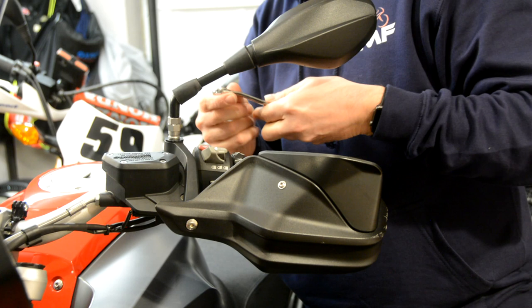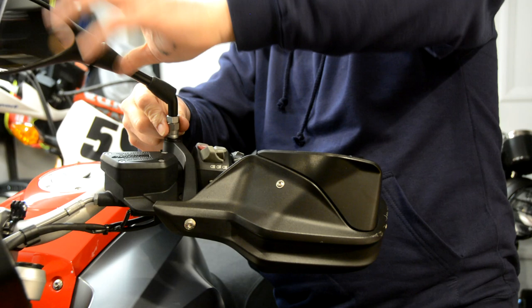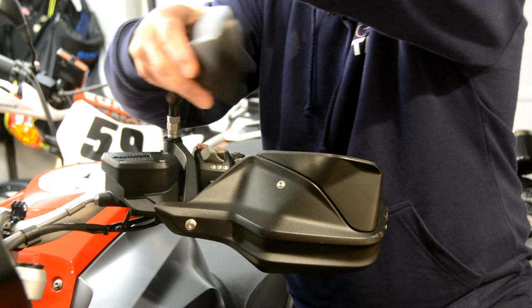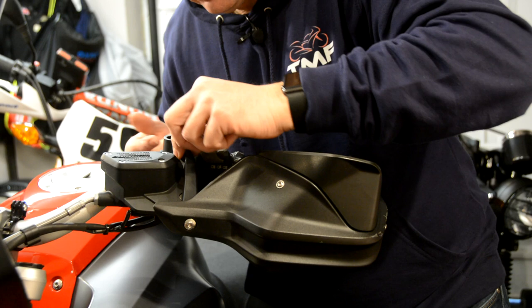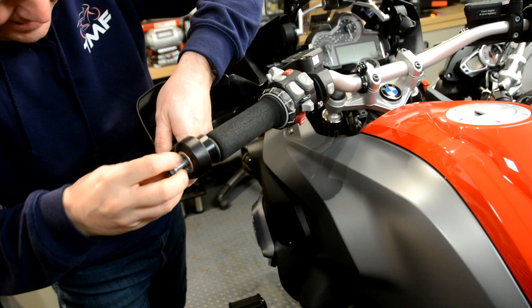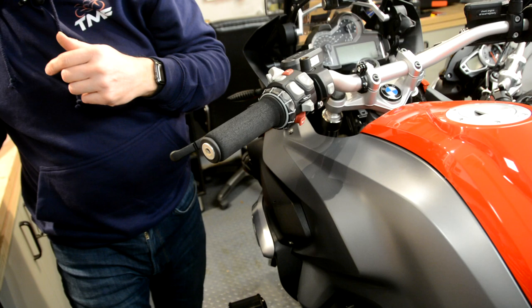Right — push back cover, it says. Up you come. And slacken lock nut, which is that one. These things are never straightforward, are they? There you go — we won't lose that washer. I've just moved the camera because I realised you couldn't see this end very well. So I've just got to undo this. Make sure nothing goes pinging out as I take it off. So we've got spacers and bar end — and there we go, that's that off.